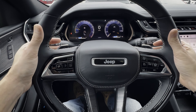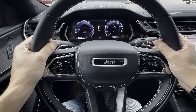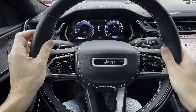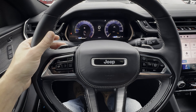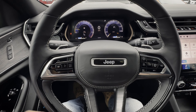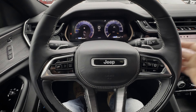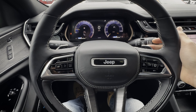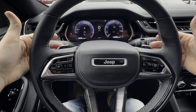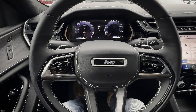This thing also has paddle shifters — minus on the left-hand side, plus on the right-hand side, very simple to use. If you want a little more speed to pass somebody on the highway, you can drop a gear as you're hitting the gas. You can also brake and hit the minus to slow down quicker, or drop for engine braking. If you want a fuller walkthrough and live driving demo of paddle shifters, you'll find that walkthrough down in the description.